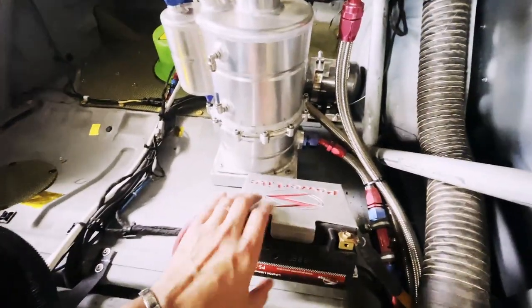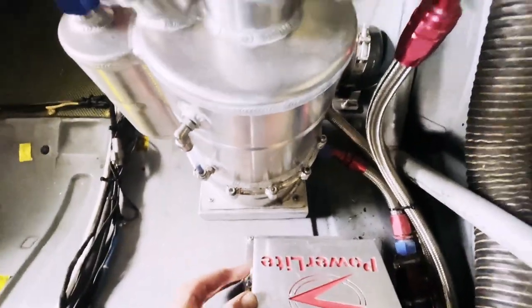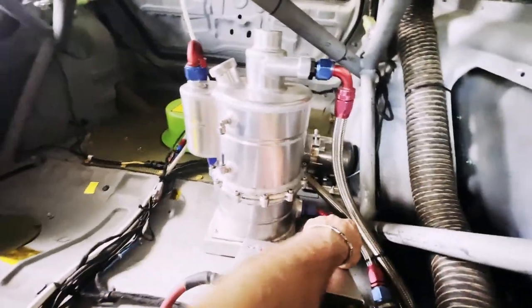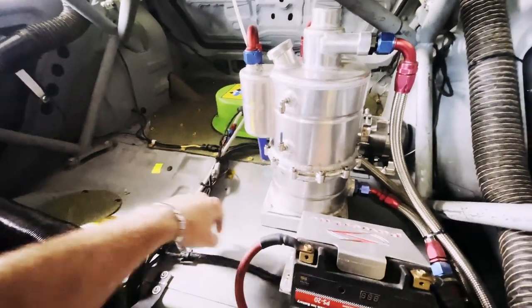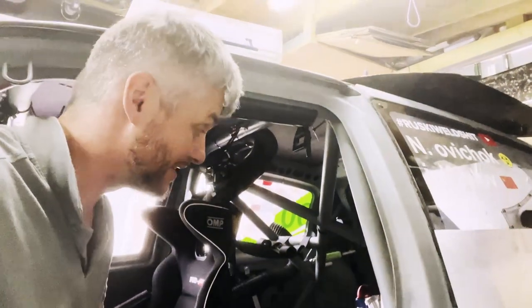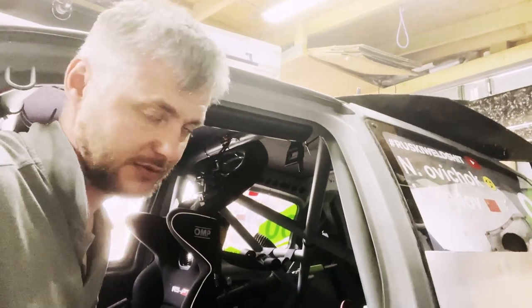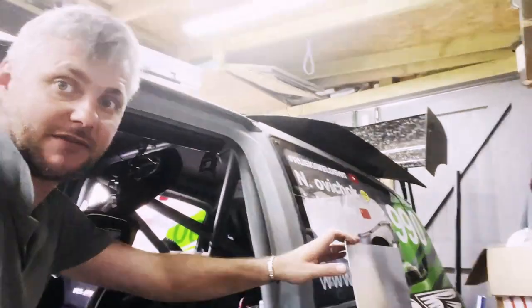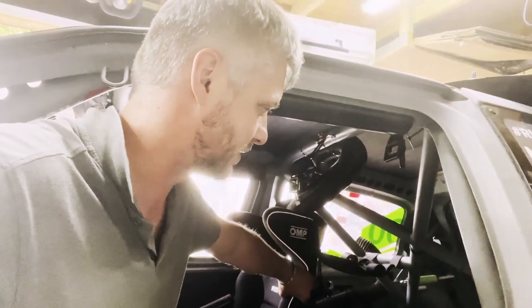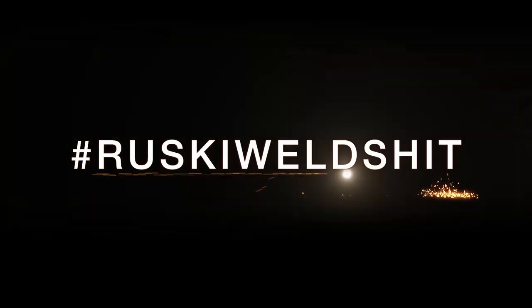I don't really want to do it but needs must. I already repositioned the battery ever so slightly higher, so now we have plenty of space around. What I'm thinking of doing is literally making two halves - one going this way, obviously with a little cutout for the hoses, and then another half as a cover from this side, and two simple bolts on each side. It will add a bit more weight but it has to be done. It says aluminum, so we have a couple of sheets of aluminum - it's two mil. I don't think anything thinner would have made a sturdy enough box. Let's measure, cut it, bend it, a bit of welding, and hopefully it will do the trick.